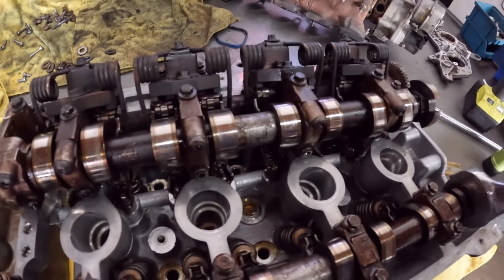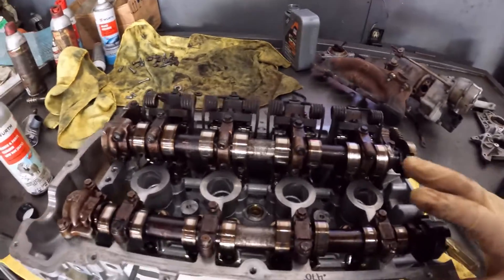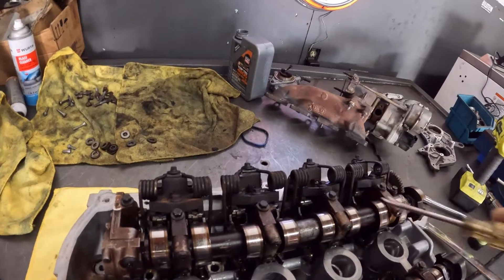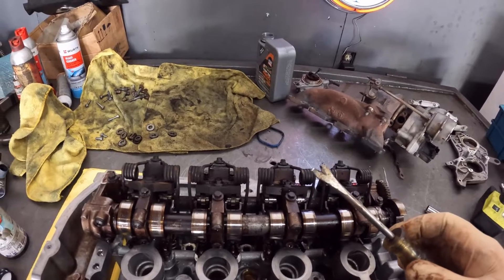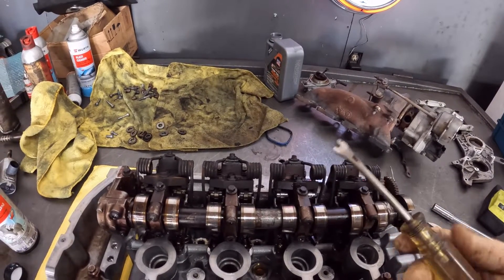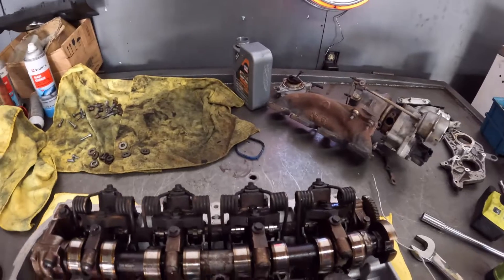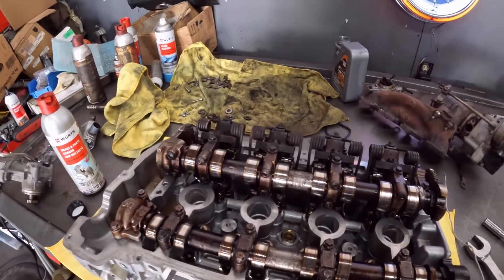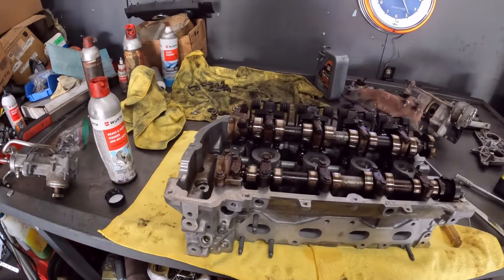So since 2008, I've been working on these things, and sometimes it's hard to see and you're like, where is it? And now I know that the rounded edge goes on the bottom. You may have seen me torquing these — they all get torqued to 10 newton meters. And you saw me putting the springs on. BMW sells a special tool, but I use this little forked screwdriver. Just go in, push on it, and it comes out. One of my guys taught me that, and you saw how fast I was able to install it. Even years in the game, you're still learning stuff.